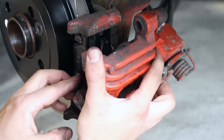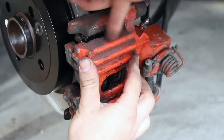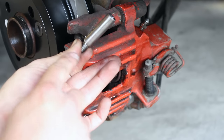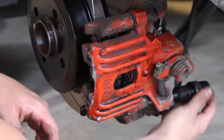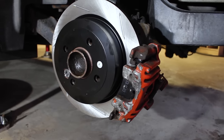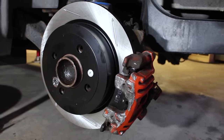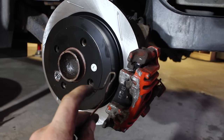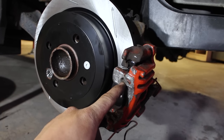Mount the caliper over top of the brake pads, rotor, and everything else. To make sure the caliper slides nicely, insert the two slider pins — lubricated with 3M silicone paste — one up top and one on the bottom of the caliper. Last but not least, install the little retaining clip on the rear bracket. A lot of German cars have these clips that hold the caliper against the bracket. I like putting a little bit of copper anti-seize on the tips of the clip to make sure this steel wire doesn't seize inside the steel hole in the caliper.